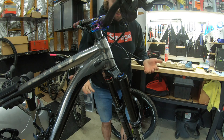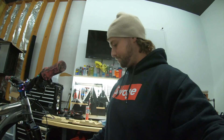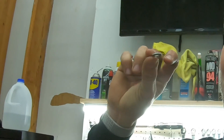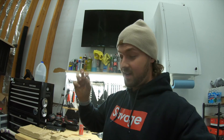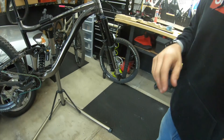Let's clean this up. We've got to tighten all the bolts and grease the axle. Since it's a 200mm post mount like I said earlier, find yourself some washers — I found some that are a millimeter and a half thick. You want to separate the difference, so one and a half millimeter spacers between your caliper and the mount gives you the extra three millimeters. Put those on, put the wheel on, and let's see how this thing rolls. I'm excited — this thing's freaking sexy.